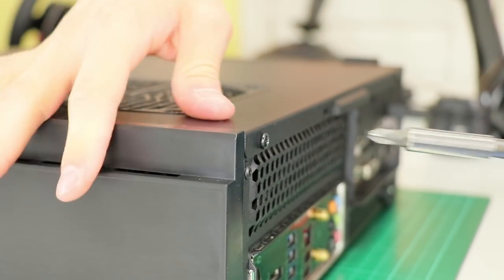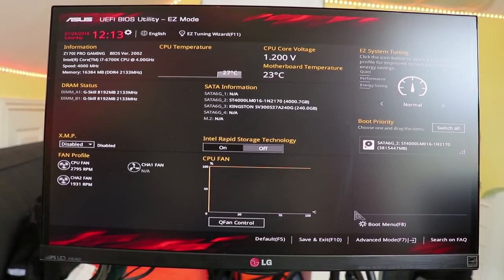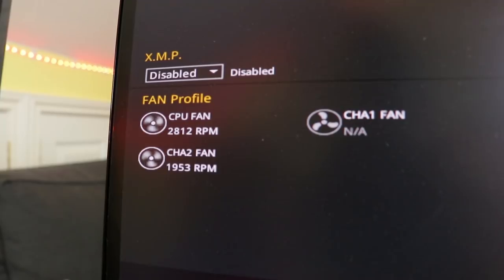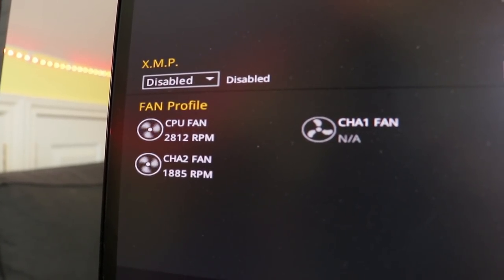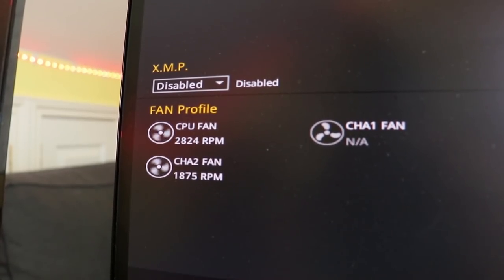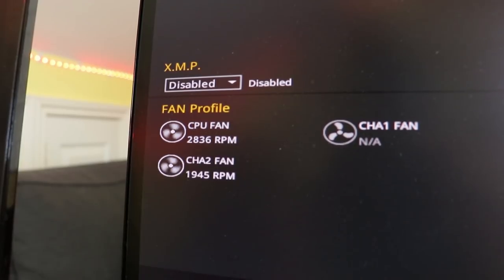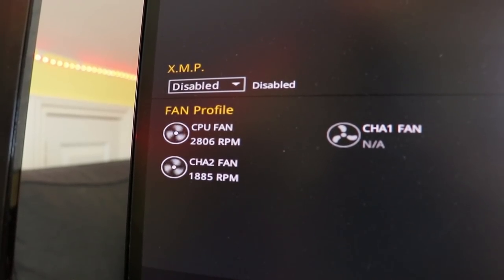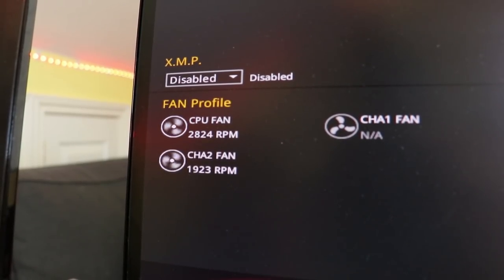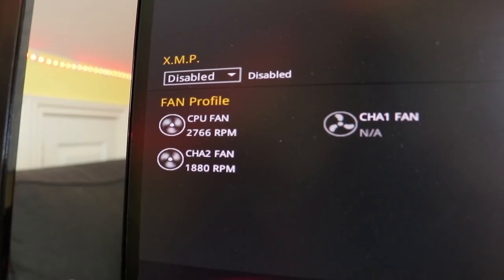Something I found interesting with the max fans test setup was that the 2500 RPM fan of the CPU cooler, which generally runs at about 2600 RPM, is actually running at 2800 RPM, with the 2200 RPM case fan assisting it. But it's also interesting to know that the fan above the CPU cooler is running at about 1900 RPM, where it's rated for and has run at before 2200 RPM. There would appear to be some noticeable back pressure due to the confined space behind the fan.